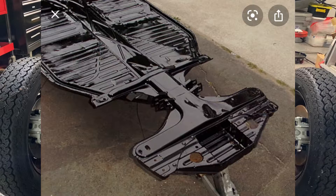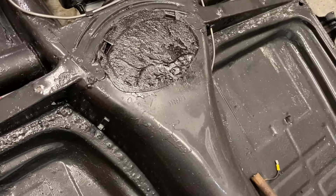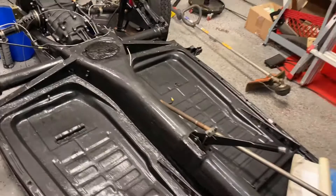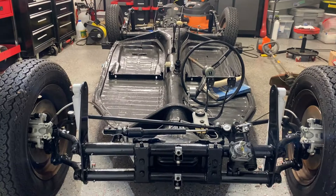It's a totally different setup, as you can see. You can look at the VIN number in the back. There's a VIN number back here and an inspection plate. You can look that up — use your repair manual and cross-reference it. I always recommend having a repair manual when working on these cars. So if you don't know what you have, you can look at that number and cross-reference to see whether it's link pin or ball joint.